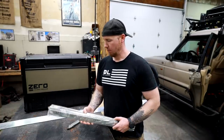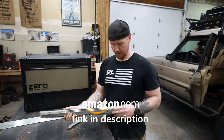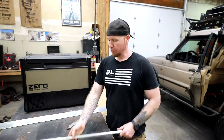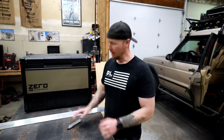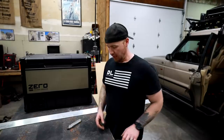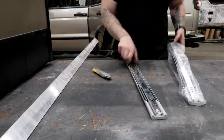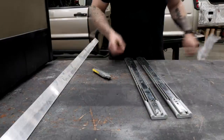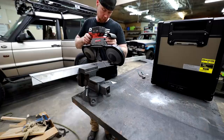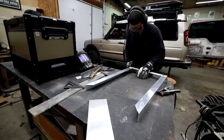Now we've made it to the fun part. We've got two 300- to 400-pound slides - they should go full length and they're pretty heavy duty. What we're going to do is build what I would call a basket - some sort of supporting structure that's going to go around the bottom rim of this fridge. Then we're going to connect it to the slides, and then we're going to connect the slides to the inside of the rover.